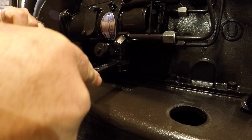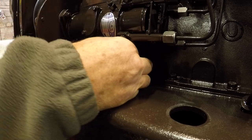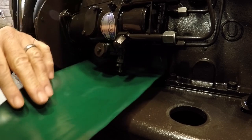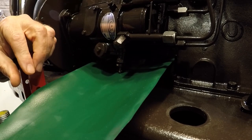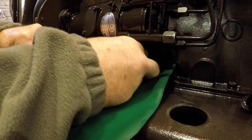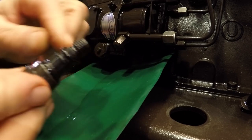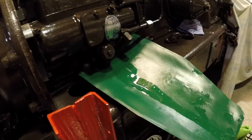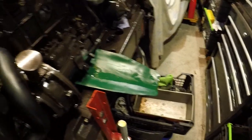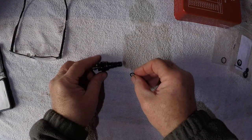Come in with a three-quarter spanner, loosen the body off. Get the little funnel in, get things prepared, and then simply unscrew and take it out. The diesel will just drip out - see, it's not running, it's just dripping. Drips down there, gets caught in the tin, saves a mess. Those funnels are absolutely amazing things - everybody needs one.